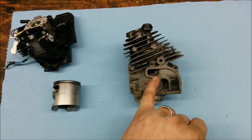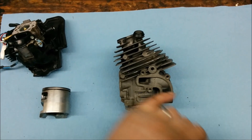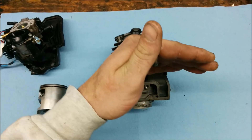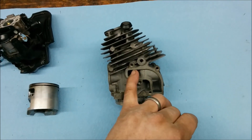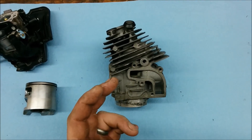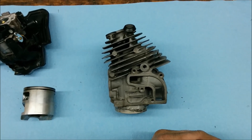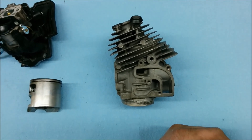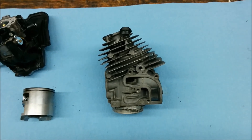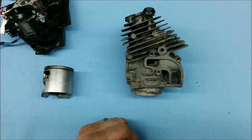The reasoning behind this — filling the upper transfers with clean air — is when the charge is fired and comes down to scavenge, leaving the exhaust port, the transfer is open and the initial charge, the clean air, that swirls around in the chamber and chases the exhaust out will not have any fuel in it. That's what essentially makes a regular two-stroke dirty: it's hard to time that cutoff point, so you're not throwing raw air and fuel mixed out the exhaust and burning dirty.